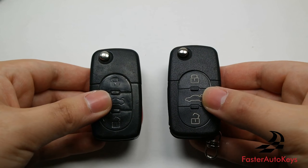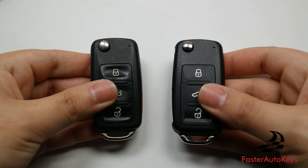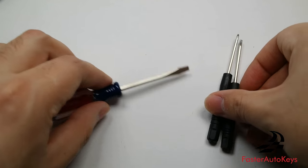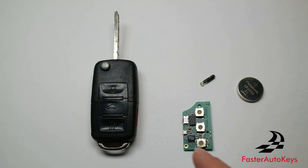We do have those keys in stock. If you have the newer 2010 and up Volkswagen keys, this tutorial is not compatible — however, we will create a tutorial and it will be linked in the description once available. What you will need for this tutorial is a small Phillips head screwdriver, a small flat head screwdriver, and a regular size flat head screwdriver. Your original key will have three things inside: in the bottom part is the keyless remote and battery, and in the top part is a transponder chip. In this complete tutorial we're going to show you how to change the bottom half and the top half into a brand new key case.